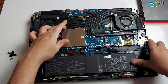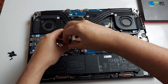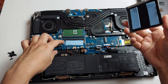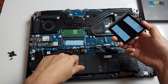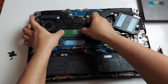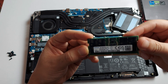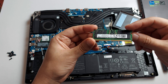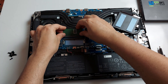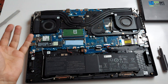Under this heat sink shield, which is attached with a screw, is the RAM. The RAM actually has thermal pads under it — it's sandwiched between two thermal pads. There is one 16 gigabyte Samsung module in there, rated at 4800 megahertz. You can add another one, and I believe you can go up to 64 gigabytes without any hassle. The shield is there just to keep the RAM cool from the heat the CPU produces.